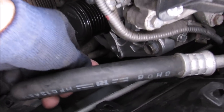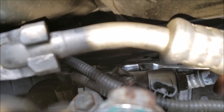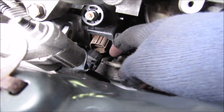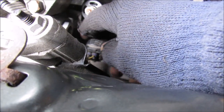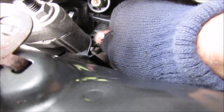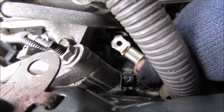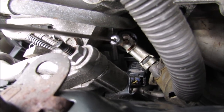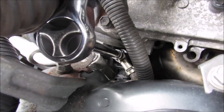Now over at the side of the alternator, we have this 10mm bolt that holds that bracket over there that secures the wire harness. And here I've got my ratcheting wrench tightening up this 10mm bolt. Next thing we need to do is plug in this electrical connector for the voltage regulator and engine warning light. Make sure that's nice and secure. So next I'm going to attach the large positive cable to the alternator. And then I'm going to come in with my brother's magnet and put that nut on there and just thread it on, and then I can tighten up that 10mm nut.